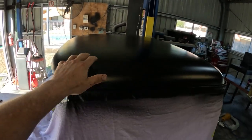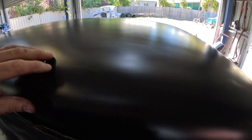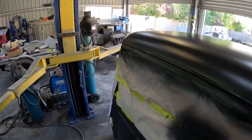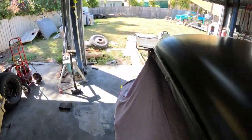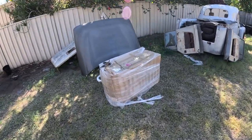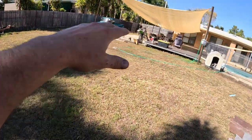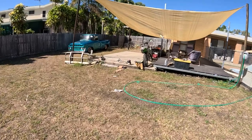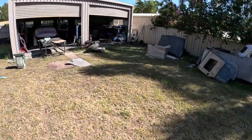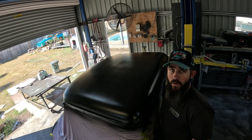So like I was saying, the roof I need to scuff back. I can see a few little imperfections, a couple of bits that landed in the paint, maybe a few little pinholes. I've got some blade putty there to take care of the imperfections - fast drying - I'll be able to sand it back, and some spray putty if I feel that's going to help it out. I've got the portable inflatable spray booth that I bought a little while ago. The plan is to set it up on the slab over here and do the top coat in there, so I won't get imperfections in the top coat. But first things first, let's get this roof sorted out.